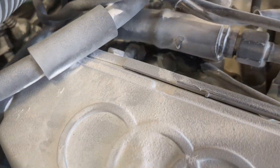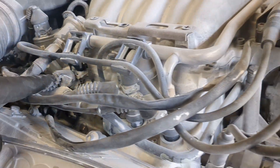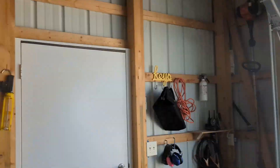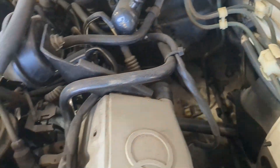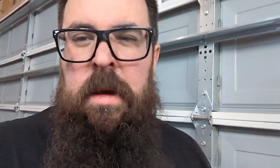All right, caught all that on video. Well, I got a little anxious there. Looks like we have an injector on number three leaking fuel. I cannot breathe in there. Now there's a little more air in here, so let's take a look at this. All right, so this injector right here is leaking fuel. Thankfully we got that fire out quick — didn't melt any lines, I don't think. Yeah, this guy's leaking pretty bad right there. I'm glad I had that extinguisher there and I had another one over there. Last thing I was expecting was a fire. So it is this injector — we've got to figure that out. As I'm cleaning it up, I had the realization that there was a bunch of solvent on the floor too, so that didn't help.